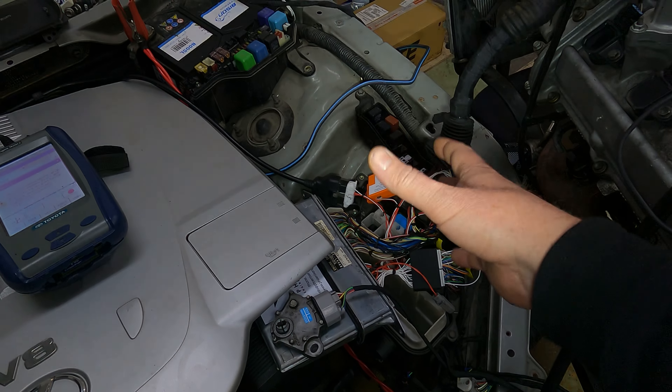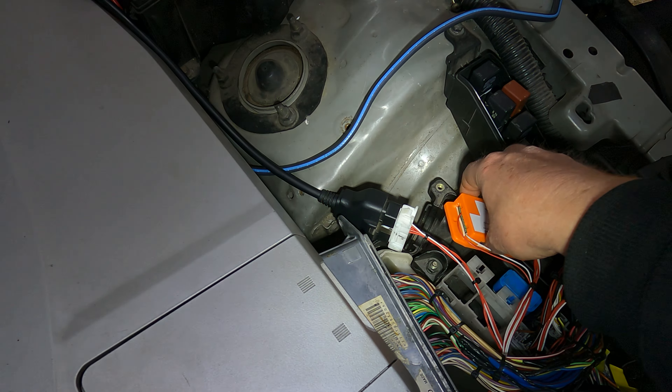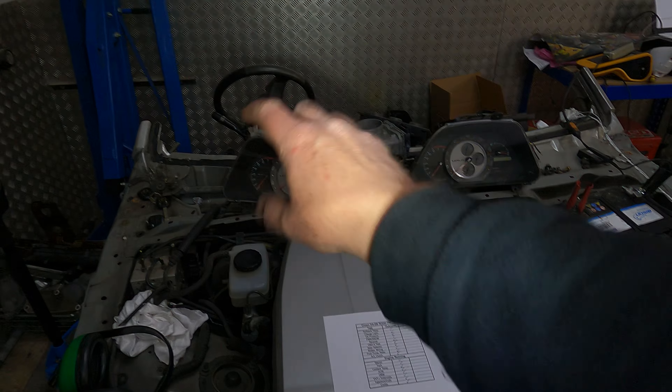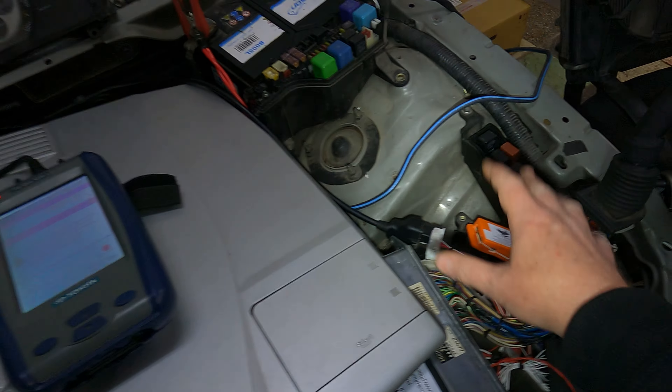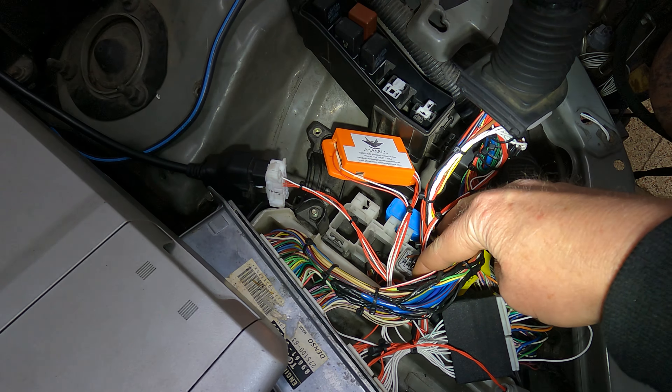SIL is the name of the pin it communicates on. We've fitted an OBD2 connector inside the ECU box so you can interface with the ECU. Obviously there's no allocated wiring in the IS200 to operate by CAN. So basically: five plugs there, two plugs there, two plugs on the body.